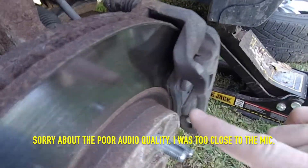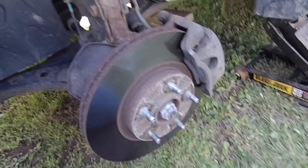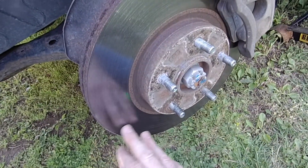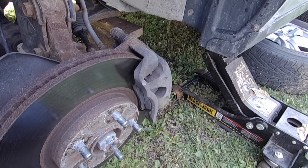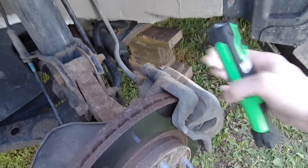So here are your brakes. You can see how worn down those old pads are. You also want to inspect your rotor, but this one's actually in good shape. So that's why we're just going to be doing what they call a pad slap today and just replacing the pads. We will be inspecting the slides and everything to make sure that they function properly.